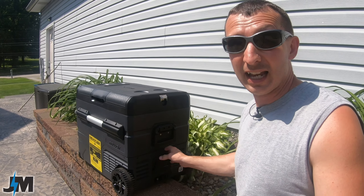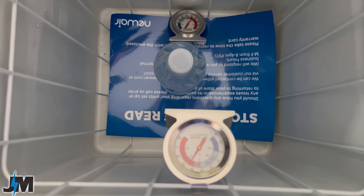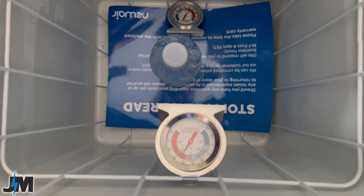I've had this cooler for a few days testing it. On my first battery test it ran for a good five hours before I fell asleep. On the second test with freezer mode on one side and fridge mode on the other, it ran for eight hours straight at 75 degrees ambient — I was super impressed. If it's hotter out, like 85 or 90 degrees, you might get maybe half of that, but you should still get at least around four hours even if the refrigerator runs almost non-stop.